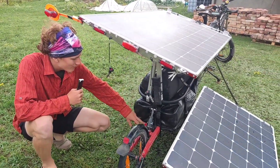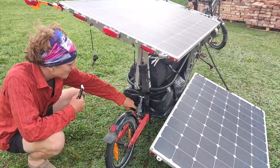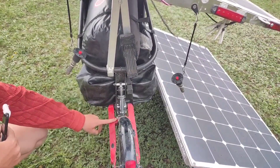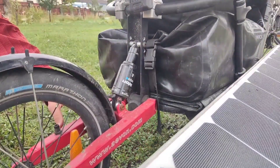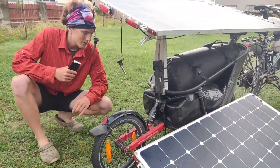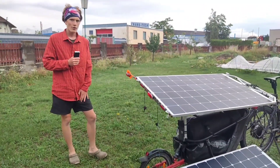When we bought the trailer it wasn't working very well — there was a big gap and we had to add a washer. It was also mounted with a quick release that had a lot of play, so we just replaced it with a bolt. We were a bit disappointed by Avon, but we made it work.